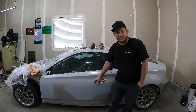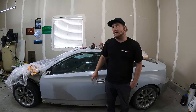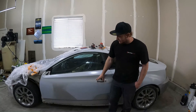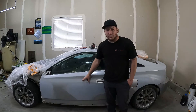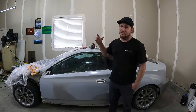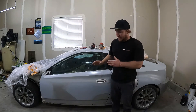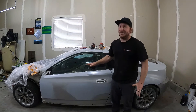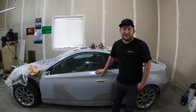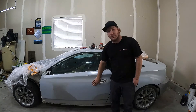Even though I soft-edged this with tape, there's still just enough buildup that if you're not careful you might see that later. When you load it up with guide coat, just past that primer line will be a nice little hazy black edge letting you know you have more to block — you need to be more thorough, use the proper pressure and angle. So I'm going to get this whole car guide coated, especially our epoxy primed and spot primed areas.